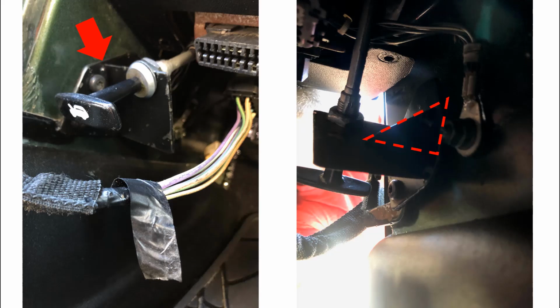The release cable handle is intended to be installed on the right side. However, it can be rerouted to the left side. You will have to use your skills and fabricate a bonnet release mount bracket. It will fasten to the existing holes inside the cab close to the door catch hook. I welded a triangle piece of steel behind the bracket that I made to make sure it was really rugged. And it was. It doesn't move at all when you pull on that bonnet release.